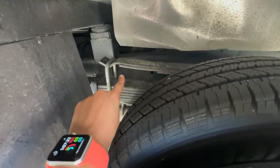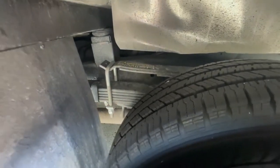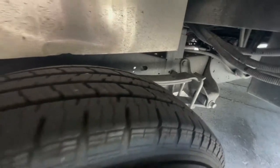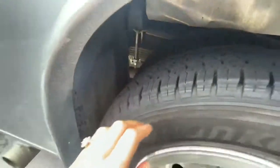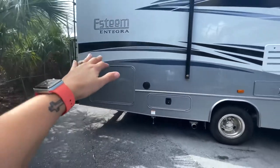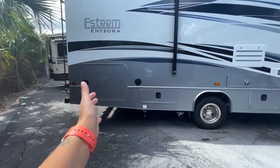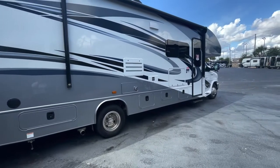Your second upgrade on both the EasyDrive and EasyDrive Elite package — and I'm a visual person, so this really helped me — is this inverted leaf spring. You see that Helwig symbol right there? The Ford chassis will come with this leaf spring, but then Integra is going to add this inverted Helwig Helper Spring across the top. What that's going to do is bring that rear-heavy load back towards the center of the coach and give you better stabilization of the unit. You've got this storage bay back here — if you load that up, it's going to be very rear-heavy and the unit will sometimes do what's called porpoising, where it bounces up and down. So it's super important to have that Helwig Helper Spring to lighten the load off the back end and give you a better center of gravity driving.